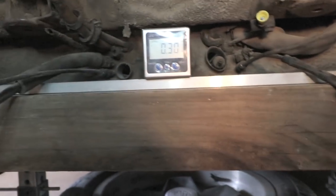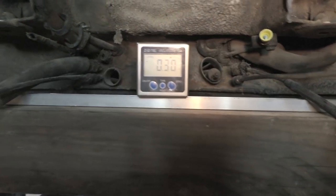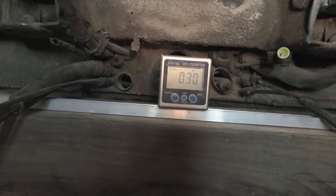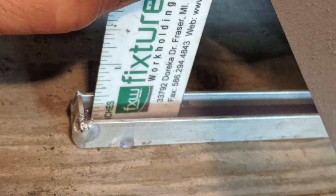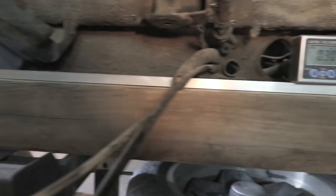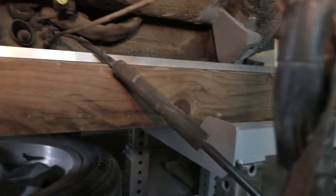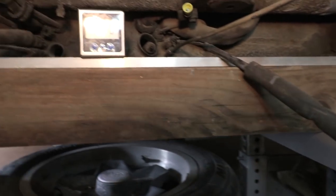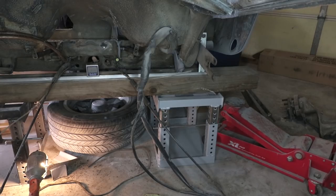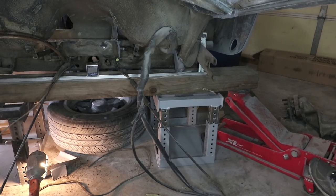It's showing a 0.3 degrees difference between the left and the right, which doesn't look like much. But I've measured with a ruler on the ends and it's off by an eighth of an inch — that's why I believe in the spirit level. I think it's more accurate than this digital level. So I'm going to jack up this side of the car so that the spirit level liquid is consistent from left to right, and then I'm going to zero out this gauge and base everything off of that.